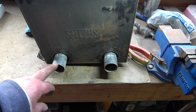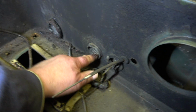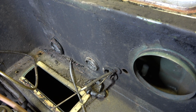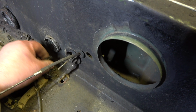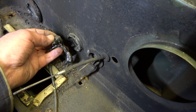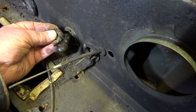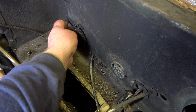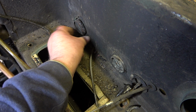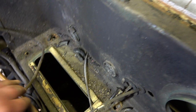First of all, we've got the heater box here with the matrix inside, and the in and out for the hot air. So coming across, those 2 pipes slot in to the hoses here that go into the cabin, and yeah, as you can see, in order to seal the pipes, they've actually used mastic, which is not a good idea, because you can see it's totally useless. And the same on the other side, and yeah, it's just coming off in chunks, as you can see.